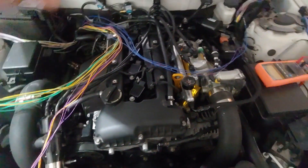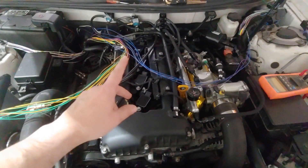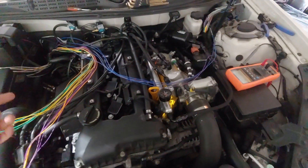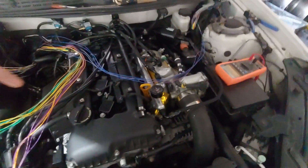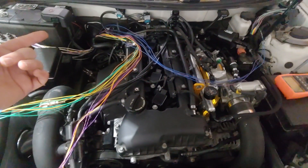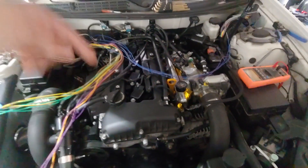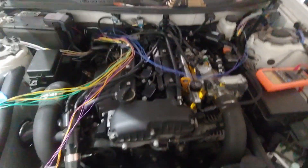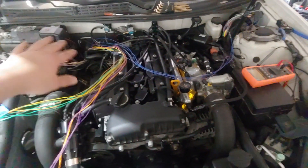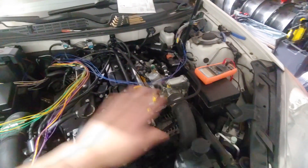That's the big thing about patch harnesses — they're like a thousand dollars. Basically if you want to do what I'm doing and just start tracing some wires, you can save yourself about a thousand dollars plus another couple hundred bucks for buying an igniter, just to run a Haltech 1500 or 2500. The benefit to the Haltech now is that if you ever engine swap, or want to reloom the entire bay and only run on the Haltech, you have the flexibility to do that.